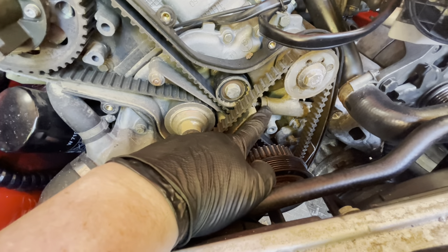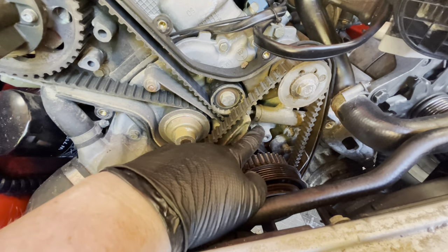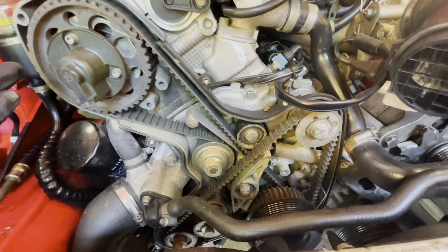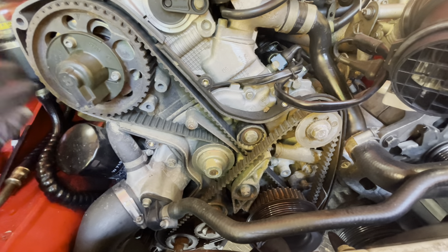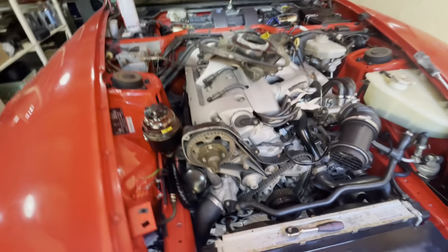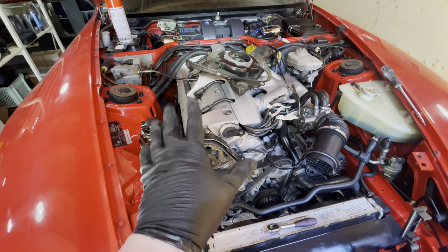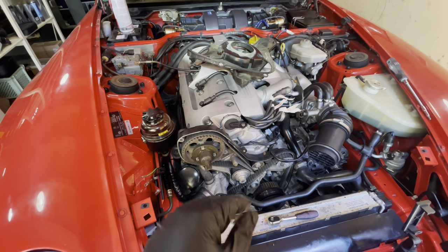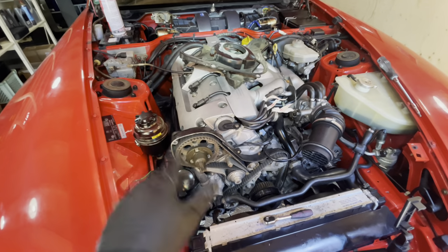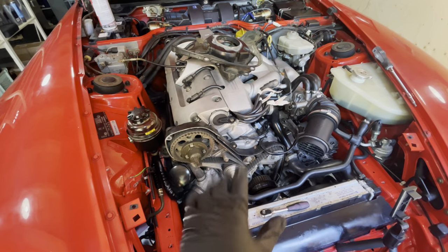These automatic tensioners are no longer available, but I did see some news — I believe it was Renders — saying they will be coming available again. For the rest, this is pretty much the same as an S2 and very similar to a 2.5 and 2.7 liter 944. Now I'm going to remove the spark plugs and spray some fogging oil down the cylinders, because this engine has been standing still for 10 months. It's just a precaution — it makes me feel better, especially since I don't quite know the condition of the engine.